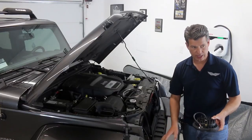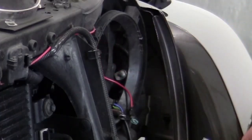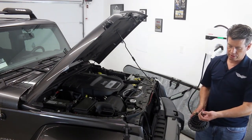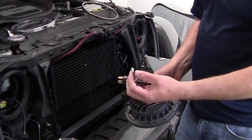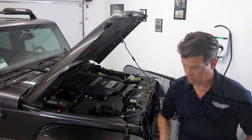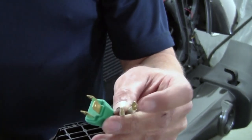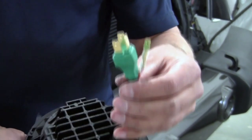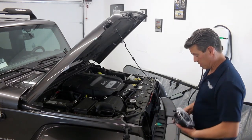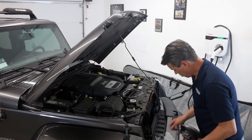Headlights out — we'll do the second one and there we go. One thing I noticed right away is that the connectors here are female, and we had male connectors on the new headlights, so this may be a bit of a quick adjustment. Both of these are now male instead of female, so it's a little bit of a problem. Hey, when you put these kits together, try to make the connectors the same so they're easier to replace. Let's take a look anyway and make sure the fit is good.